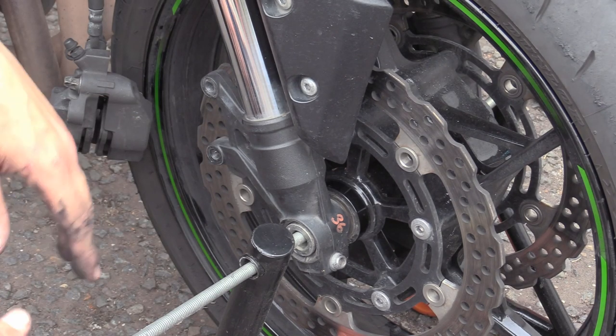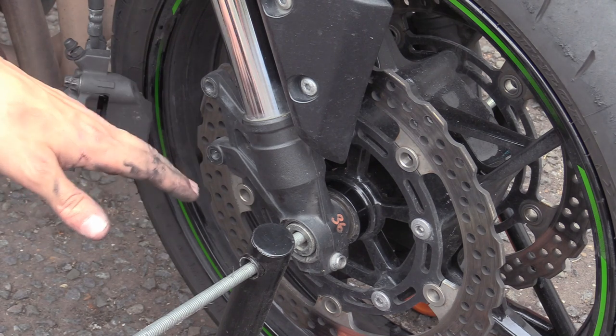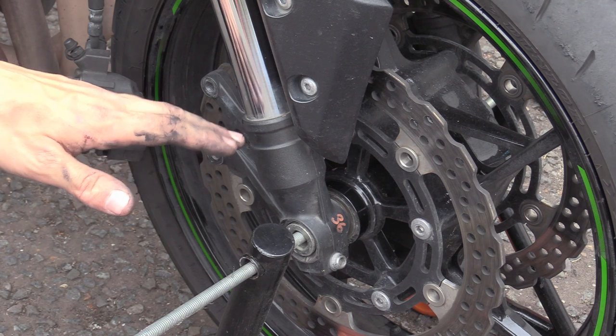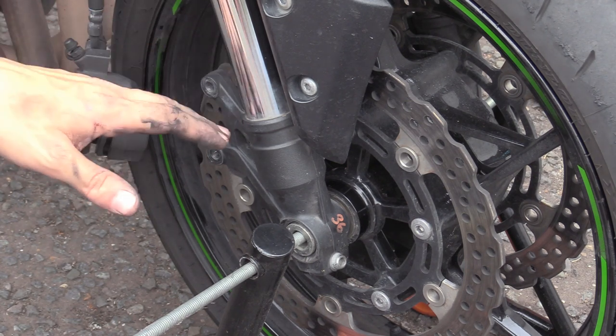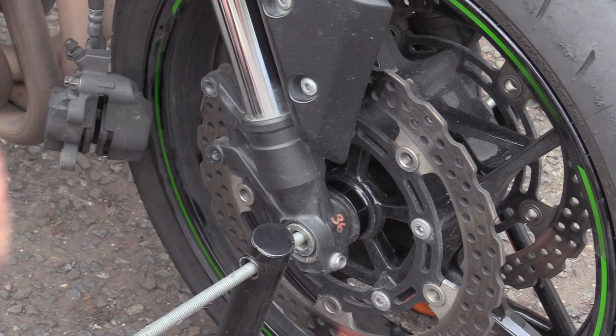The opposite is true for when you go on track days and racing, you reduce tyre pressures. The reason you reduce tyre pressures is because the tyre's under so much stress and gets so hot that the air inside will get hot. And if the air inside gets hot, the pressure goes up. So it's that PTV stuff, or basically just Bernoulli's principle and all that kind of rubbish.